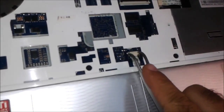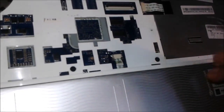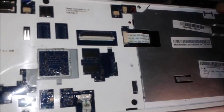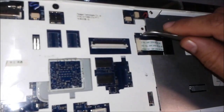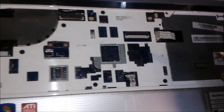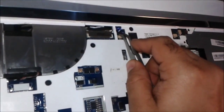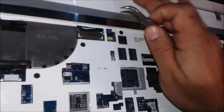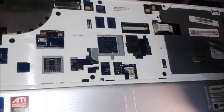On the bottom side there's one jack for the touchpad cable — we remove that small jack. There's one more cable that goes to the power switch and light — internally this cable comes in here, so we have to remove it too. Once we open the top cover, all connected cables must be removed. This small jack here is for the LCD screen, connected with the motherboard on the bottom side.